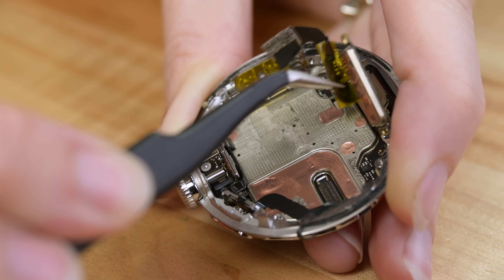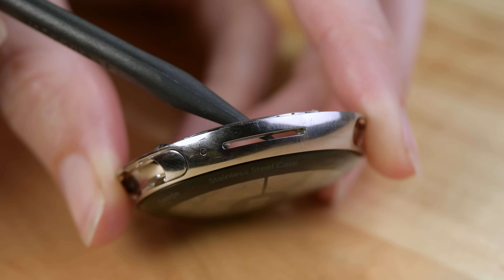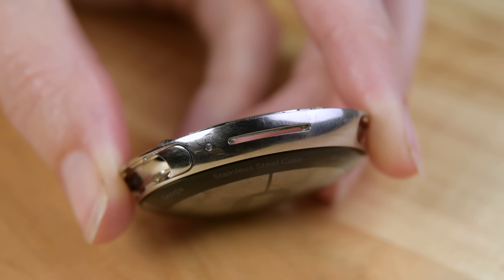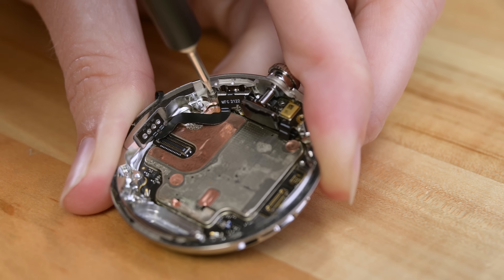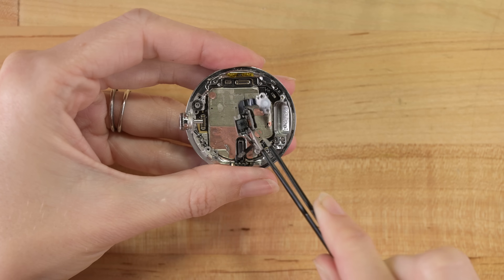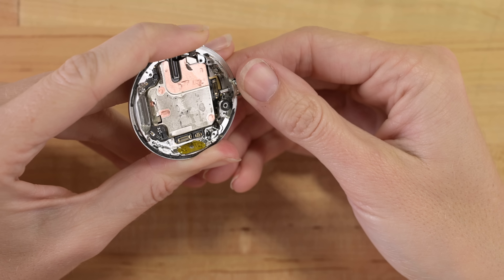After much scrabbling, I opt to pry up this cable thing, and a speaker — hey wait, this grille has no grille. The large slot in the side of the watch relies on the speaker's own grille with no extra mesh. Definitely not a dive watch. I still don't have anywhere to pry, so let's make some more mess. Time to dethrone this crown. Hello, depth sensor — and voila, the optical sensor. This little guy is likely reading notches on the tactile crown to determine its position as it rotates.